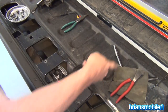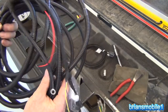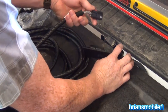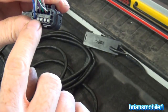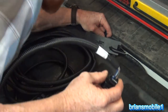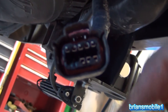That little short harness is in, the one that goes to the truck is in. Now bear in mind this has to run the length of the truck, but that should go pretty quick. This is plug A — it goes to the harness here and it does go together. But we have to pull out pins 7 and 8. If you look at the bottom it says plug A on the right hand side — that's 10, this is 9, this is 7 and 8. These are the two plugs that you pull, and you just transfer the green wires: there's a green and orange, and a light green and orange. The dark green one goes on the left and the light green one goes on the right.